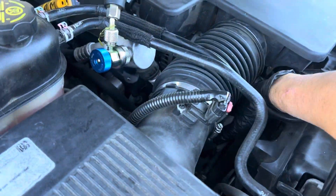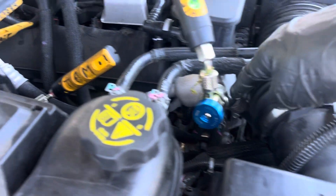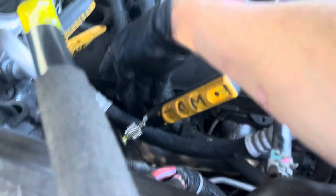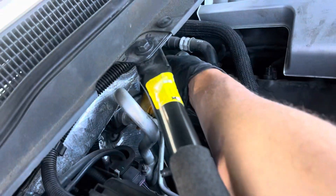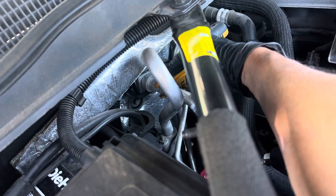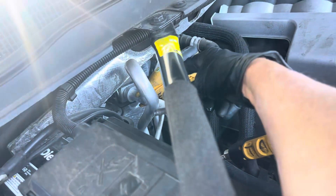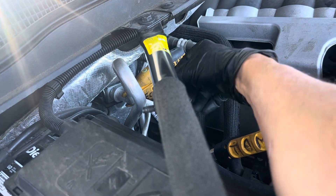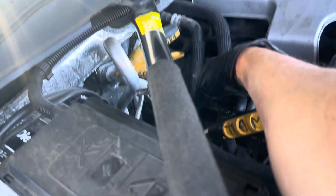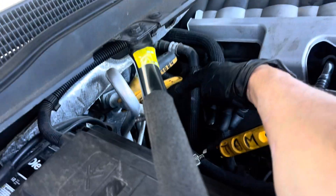Here's an example: I have hot air blowing out at about 180–190 degrees, blowing over the exhaust manifolds which are in direct line of sight. They're heating up my gauge — even though the line is cold, the plastic that my thermocouples are attached to is really hot. That messes up my gauge readings because I'm getting convection heat blowing over my sensors plus radiant heat directly contacting my sensors and roasting the plastic.